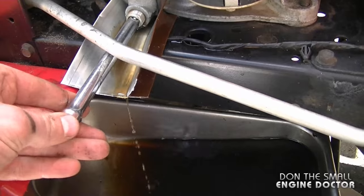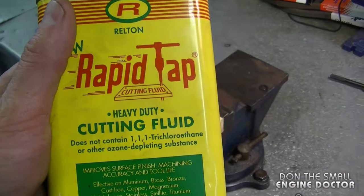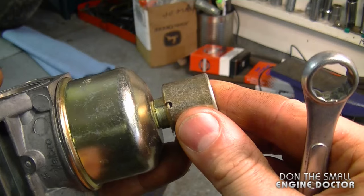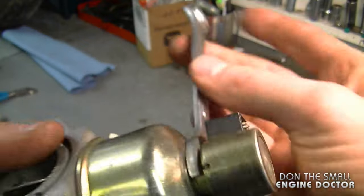The tools you're going to need today are a quarter-inch tap and some oil — preferably cutting oil. To get started, remove the solenoid at the bottom of the carburetor. What I've done is ground down a half-inch wrench so it fits perfectly in there, and then you can remove it.